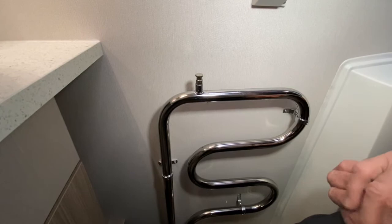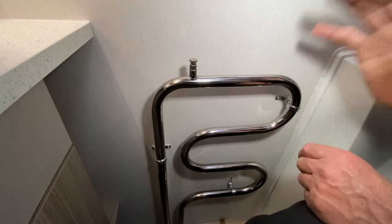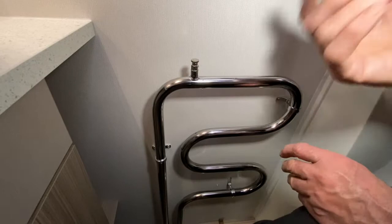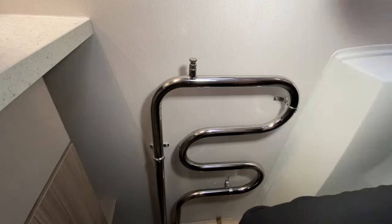It's not quite a sealed system. There is a reservoir and it's got a certain amount of fluid in that reservoir head, but it does evaporate. If it was a sealed system like you have in a car, the fluid doesn't evaporate that quickly. But on this type of radiator system, the fluid in use does evaporate, so be aware of it because it does need topping up. I'm going to move over to where the reservoir is, which is in the wardrobe location just next door to this area.